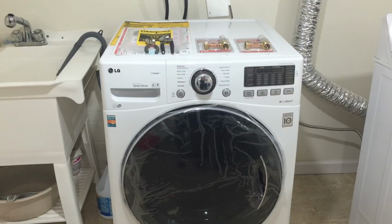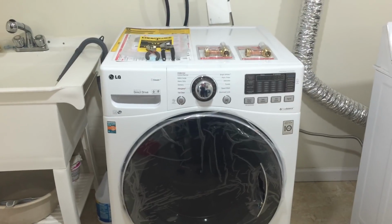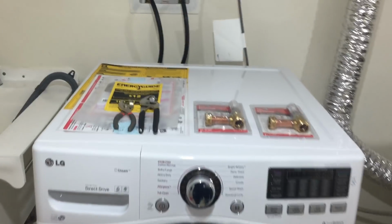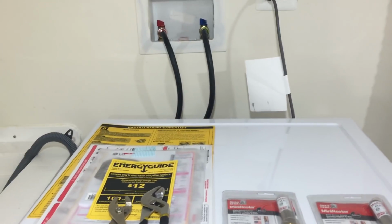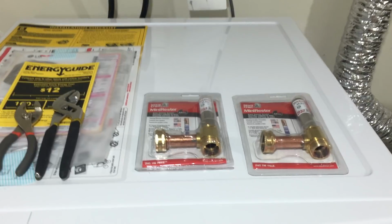That's actually what is causing this: the water valve that was designed by LG. When it first starts, it opens and closes and causes a rapid burst. And that will cause a lot of high head pressure that causes the pipe to start banging. What we call it in plumbing is the water hammer.